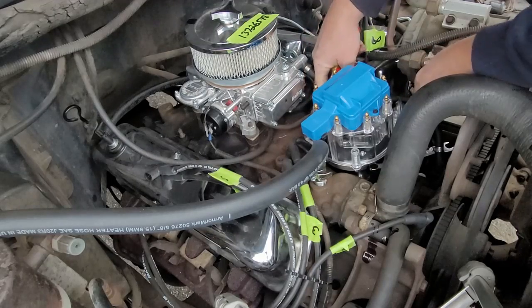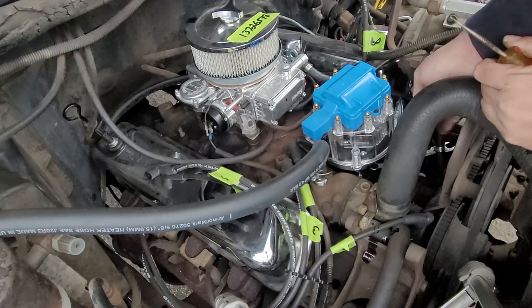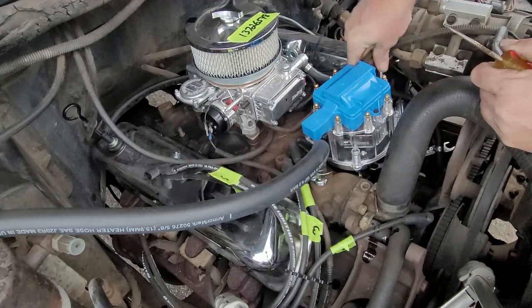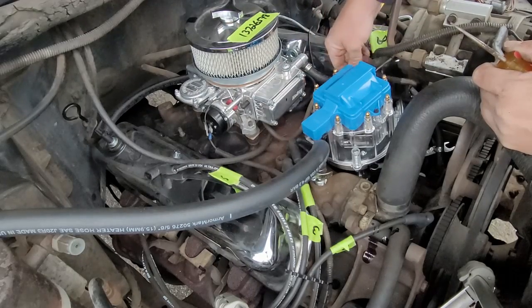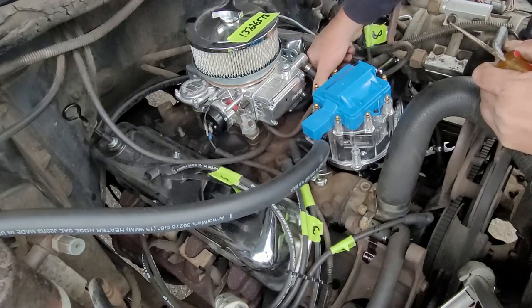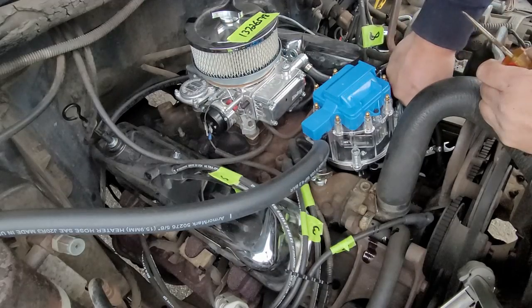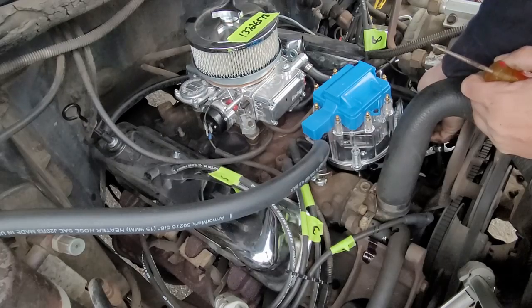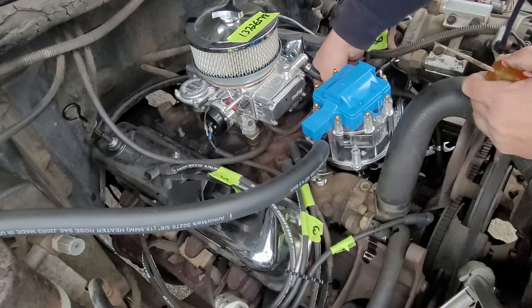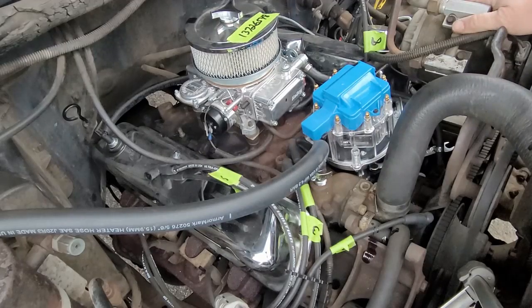This is a bigger distributor than the one that came out, so certain things may have to be modified and or adjusted, like the rerouting of certain things. Take your time and see how your truck feels or car feels, the best direction they will be into without hanging up on anything. Okay, I can do this right here without kinking it. All right, cool. So that fit right on there, good. And that vacuum line is happy. As long as that's happy, I'm happy.